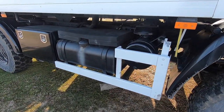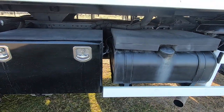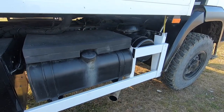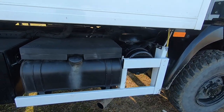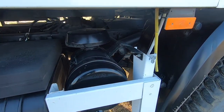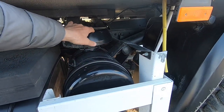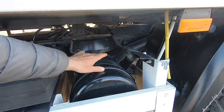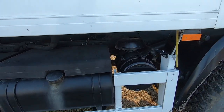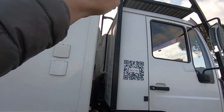One of the things I'd like to do is upgrade the fuel tank. It's currently 130 litres, and that for me just isn't quite big enough, so I'd like to increase it to 200 litres if possible — I think that's achievable. At the same time, I'll probably put on a snorkel and put it on top of the cab. So this is basically the air filter, and from a water crossing point of view, it's going to make a lot more sense if it's mounted up in this area up here.